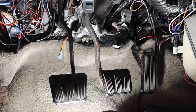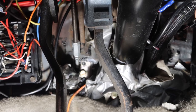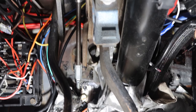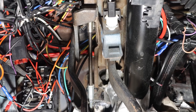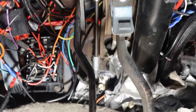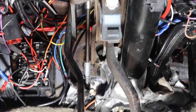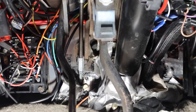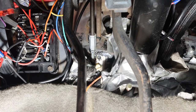Don't mind the terrible wiring job on this car, but here's what we installed years ago — our old Hydromax setup. You can see the rod coming through the firewall and going up and attaching to the clutch pedal. On this car, we ended up having to weld a tab onto the clutch pedal to get the geometry right. It works great — the car has had 10,000 plus miles put on it trouble-free — but if you're not as handy or don't have access to a welder, it could be a little difficult. So we want to show you what our existing setup looks like, which works great and might be preferred by some people, but in this case we're going to swap it out to show you what the new version looks like.